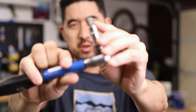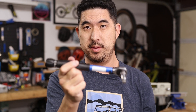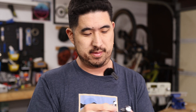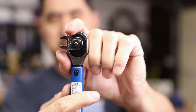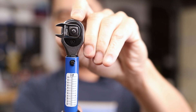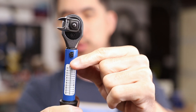Now the thing about using a click-type torque wrench like this is once you've got the attachment on — whatever you happen to be using to tighten your bolt — as long as you're holding the handle in the right place, which on a click-type torque wrench is right in the middle of the handle, you'll get a proper torque measurement out of the tool. But if you're going to be using a crow's foot like this, depending on what angle you have it set to, in theory it can alter the torque measurement you're going to get. If you've ever seen somebody use a torque wrench with a crow's foot in a how-to video, there's no shortage of people in the comments saying you have to mount the crow's foot at a 90-degree angle. The reason for that is on a click-type torque wrench, it's the distance between the pivot and the center of rotation of the tool head that actually plays a big role in producing the proper amount of torque.